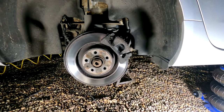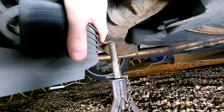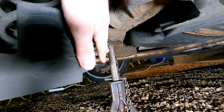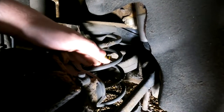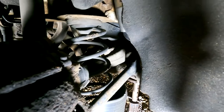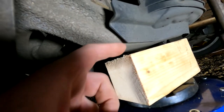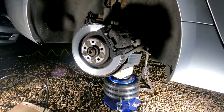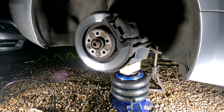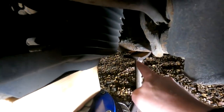The first thing you're going to want to do once you've jacked the vehicle up in the air is to get an axle stand underneath the vehicle, underneath the actual subframe, so you can drop the weight of the vehicle down onto your axle stand. That then allows you to use your jack to jack under here to compress your suspension spring so you can get the ratchet straps around them. You're going to want to position your jack straight under where the spring actually is — there's a nice flat surface just under here that you can jack up on to compress the spring.